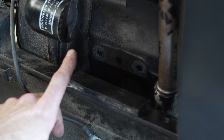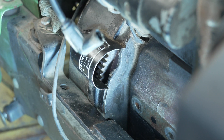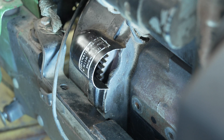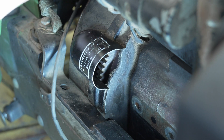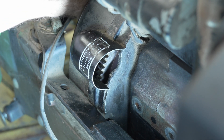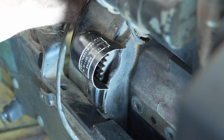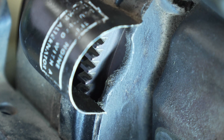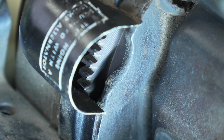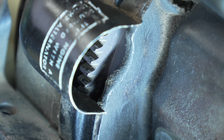Another great thing to do is to look at the teeth on your flywheel right here. To do that, I removed the spark plug wire first. Then you can just reach on the shaft on the back of the engine and just slowly turn the motor over. If you take the spark plug out, it would be even easier. Go ahead and look at all the teeth and make sure there's none that are broken or overly worn out. Mine looks really good, so we can go ahead and put the starter back in.